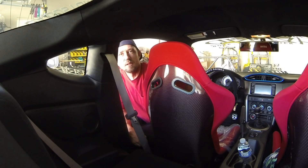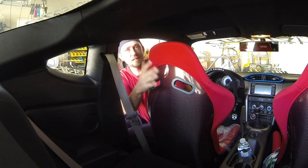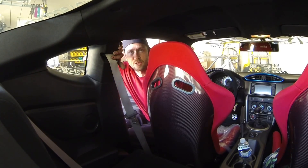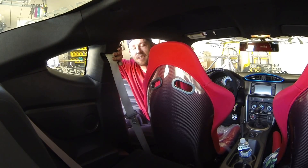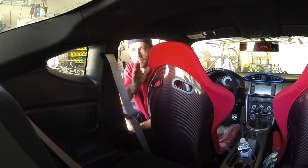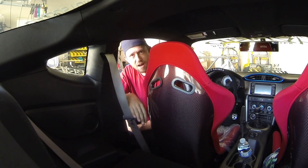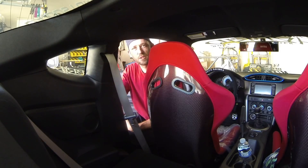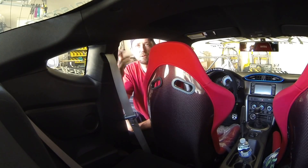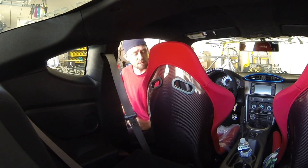We have our design in mind, so we start by figuring out where to hang the brackets and how they're going to look. On this car, underneath the B-pillar covers, we have our seat belt mounting location — that's exactly where we're going to take off with the brackets. Not every car is like that; some don't have seat belt mounting points in the B-pillars, so you have to take the cover off, find a mounting location, and possibly cut through the B-pillar plastics accordingly.